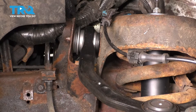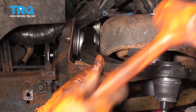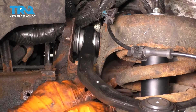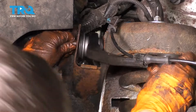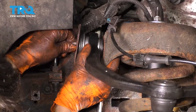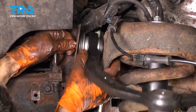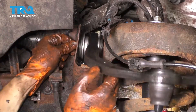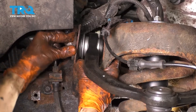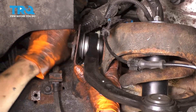Now let's fish this front bolt in. Look through the hole to make sure it lines up — if it doesn't, give it a couple taps with the rubber mallet and now it lines up perfectly. Double check that the alignment plate is in its spot; it has a little pin on the inside that needs to line up. Then get the outer piece on — it will only fit one way because of the cutout on the bolt. Make sure when you push it on that you don't push the whole bolt through. Now let's put on the mounting nut and bottom it out, but don't tighten it yet.